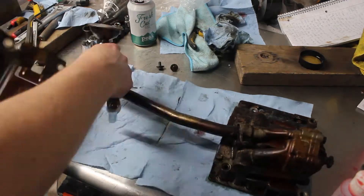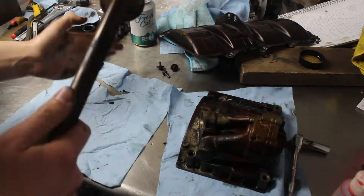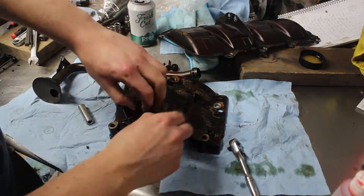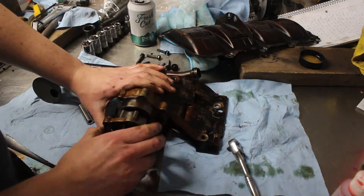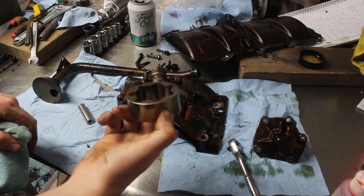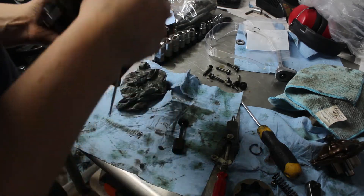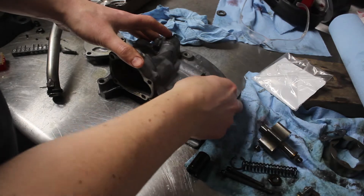I still haven't addressed the oil pump, so now it's time. I took apart the pickup tube and bracket from the pump itself, then I popped open the pump. There isn't much to replace in here, just a regulator gasket. The regulator plunger comes out, but I have to take the retaining clip off first. This is spring-loaded, and it shot itself across the room comically, but I didn't catch it on camera. After letting the pump sit in the parts washer for a bit, it came out looking like new.